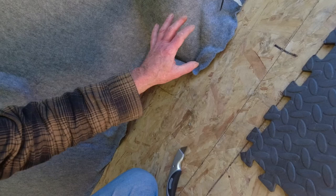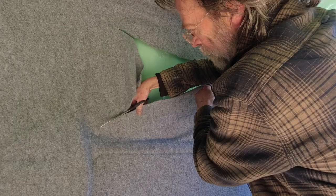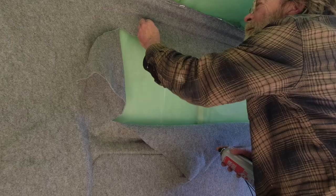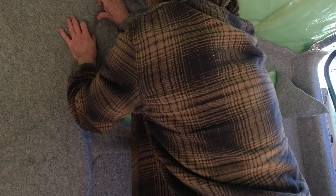I haven't trimmed that to the floor yet - there are a couple of places where I just haven't gotten all the way down with the adhesive, so I'm going to take that opportunity and spray up from the bottom to get all of that down. The first panel to do is the one which is going to be wood paneled - I've started to cut that. The idea is to cut an X shape in it, then spray it from the inside, curl the carpet around, and trim it up. So I'll just push that in there - and that's that one done and trimmed up.